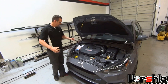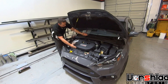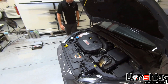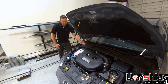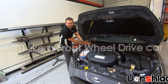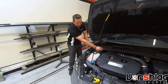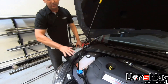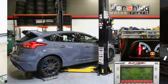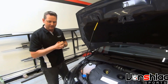We got the hood up and as you can see it's a really short engine bay — literally about two and a half feet long. Unfortunately the front axle centerline is way back here, so the entire engine is in front of the front axle centerline, which is literally behind the back of this cowl. It's got about 59% of the weight over the front wheels, which makes it a challenge to do some of the things we like to do.